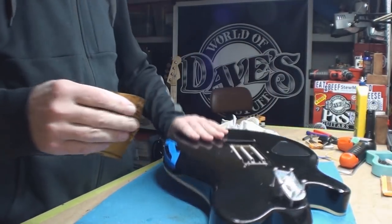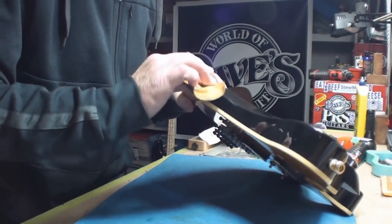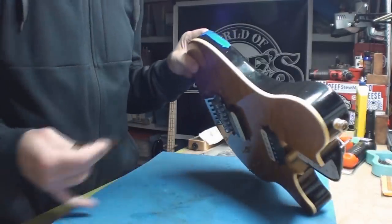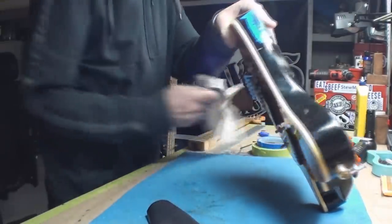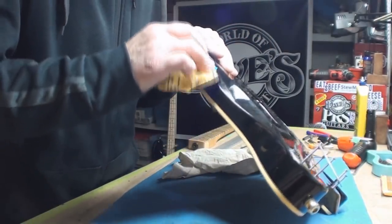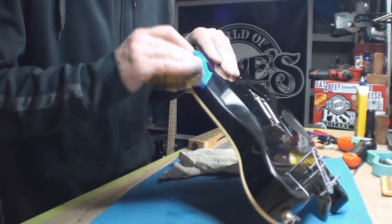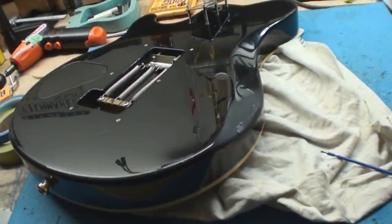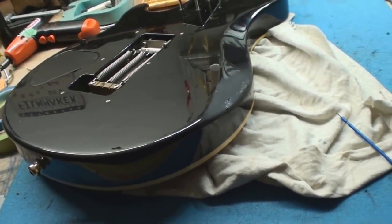Okay, now we're gonna fool around with a little bit of wet sanding where I did that repair yesterday. The chances of screwing this up are great, that's why I've got the masking around where I didn't do the repair - I just want to level that spot. It'll take a little bit of time but I'll get it, and it'll polish up. I had to do a couple little minor touch-ups and I gotta polish it, but it's definitely gonna be a lot better than it was.